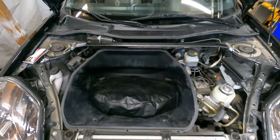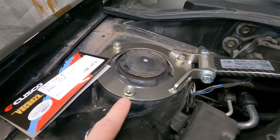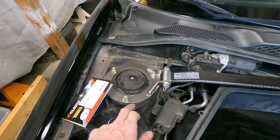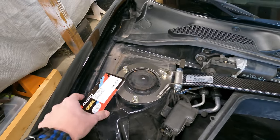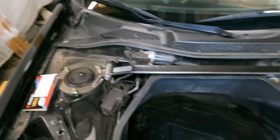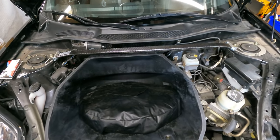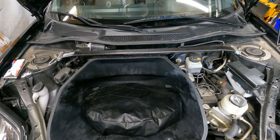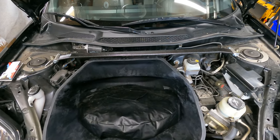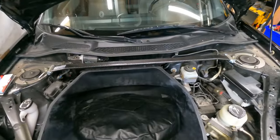This is the front Cusco carbon fiber wrapped aluminum brace. I took the spacers off on the front because there wasn't going to be very much meat left as far as the bolts coming out of the struts, so that way it's nice and tight. It didn't seem like it was going to pull on any of the seams either. Here's the model number — I'll put links in the description. This is a multi-piece construction with joints you have to tighten, just like the rear. I noticed a tremendous difference. This car was almost undrivable at 80 miles an hour until I did this — it would start hopping in the front end and felt really unsettling. This took all that away and just made it feel so much better. I do think the TRD one-piece design without these joints would have been better, but those are worth a fortune now.